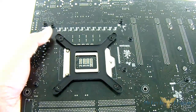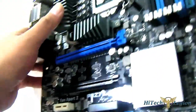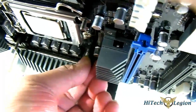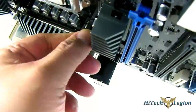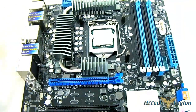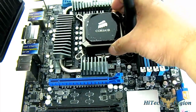To recap — I have the LGA 1155 here and I have the backplate. As you can see it is loose even though I have tightened the standoffs. That isn't an issue — it will not be a problem. There is a little bit of slack in there, but once it is completely screwed you just need to use your hands. Even though it appears loose, that slack will tighten up once you screw the unit itself onto the standoffs. It already has pre-applied thermal paste, but you can apply your own thermal paste before you do this — of course if you are going to redo that.